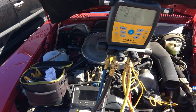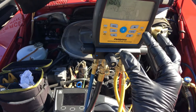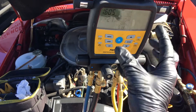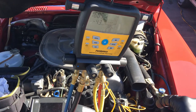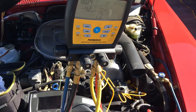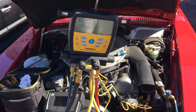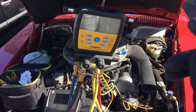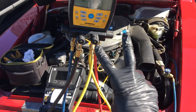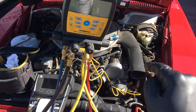Let's do a comparison. You know the can of AC Pro — they have that little gauge on them that goes up in the green area, and it means it should be good. That's usually somewhere around 30 psi, I think up to 40, 45 psi. Let's see what the low side pressure looks like on this vehicle, and if you had a can of AC Pro and you were trying to fill up this vehicle using the little gauge, let's see what our low side looks like. Let's try to determine what damage would be caused if you used a can of AC Pro with that little low side gauge that gives you the green area, and you tried to fill it up to that point. What would break?